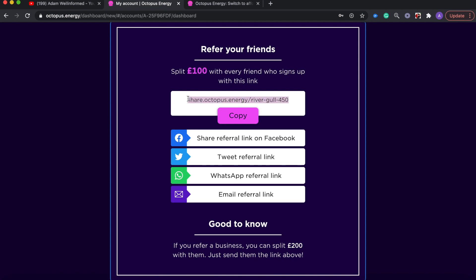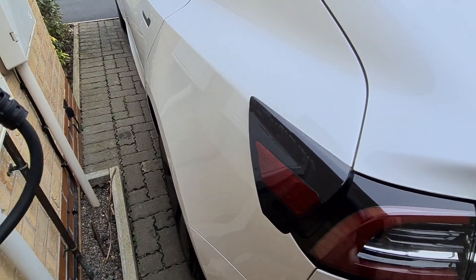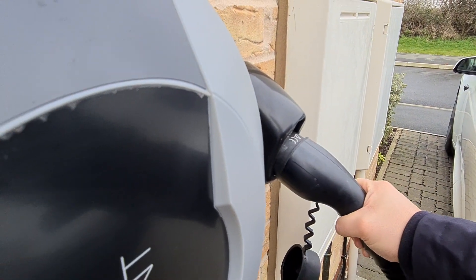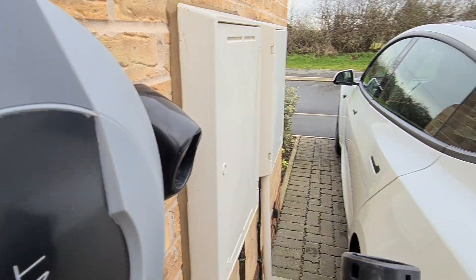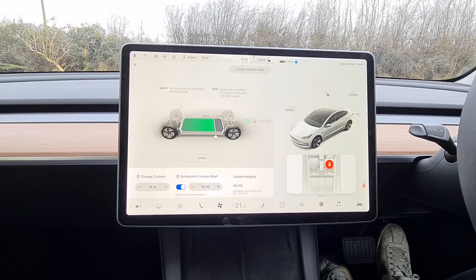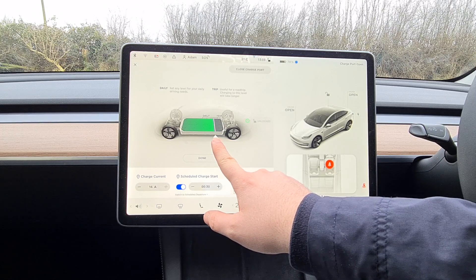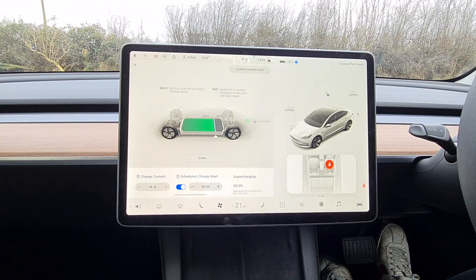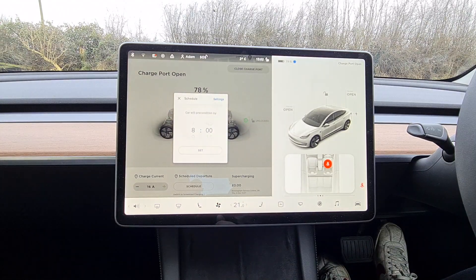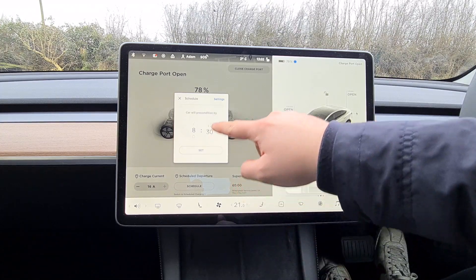So how does charging work? You open the charge port, plug in your charger, and leave it to charge to your desired level — mine being 80%. You can change the desired charge level using the screen in your Tesla or the Tesla mobile app. A 100% full charge should only be used for long trips where possible, as sitting at 100% for long periods without using the car causes battery deterioration. You can also schedule the car to charge before a set start time — for example, scheduling a charge to 100% to finish at a specific time for a long weekday journey.